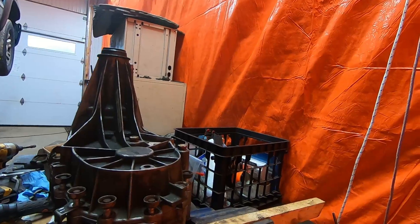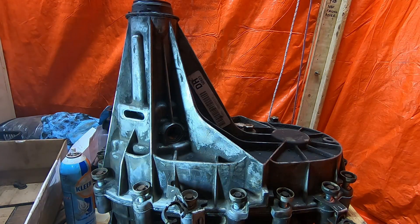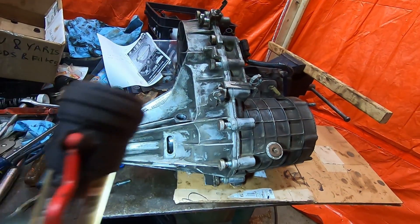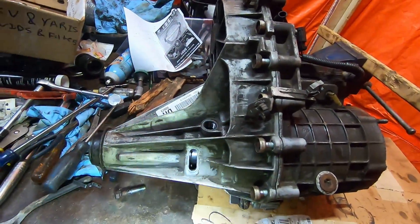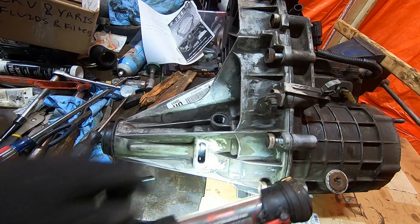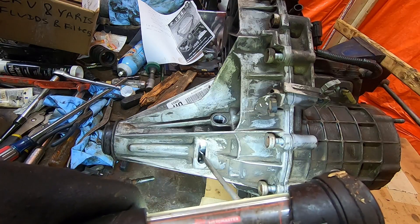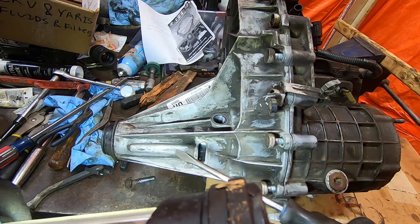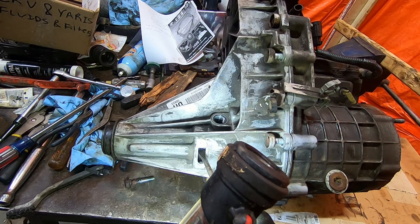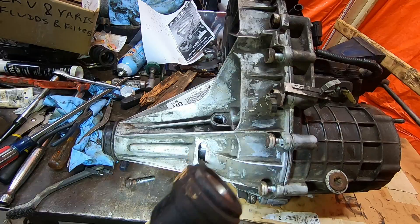Here's the tricky part. You can't just screw this down and tighten it up — you've got to seat that snap ring in that bearing. You could probably do it with screwdrivers, but snap ring pliers that grip the inside of a snap ring and open it are what you need. I laid the unit down on its side rather than trying to lift the weight of all the gears upright. I used the snap ring pliers to spread the snap ring apart, then stuck a screwdriver into the groove in the bearing and pried gently to cause the bearing to move, and then the snap ring fell into place. You want that snap ring to be in that bearing groove — when you push down on it, it should just spin like that.